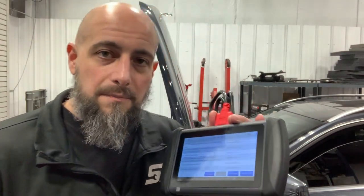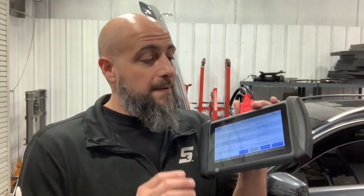In regards to the review, in my opinion I like this thing. I would call this a level five scanner. There's basic OBD which only does check engine lights; there's enhanced which does code reading plus live data; there's the four-system which does engine, airbag, transmission, and traction; then there's the multi-system one — which is what this is. It will read the whole car, all the systems. This is very good to have because nowadays in any car from about 2003 on, they have so many control modules that you've got to have a way to read all of them to see what's happening.